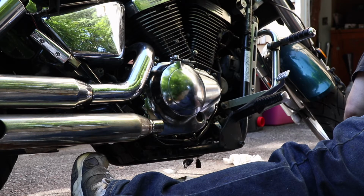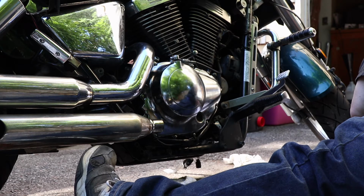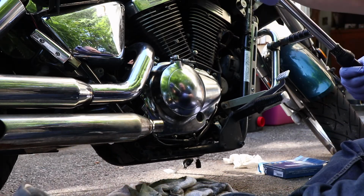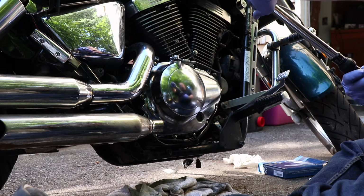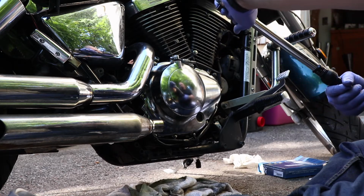Oil drain plug: 21 newton meters, 2.1 kilogram meters, 15 foot-pounds. So let's set up our torque wrench for 15 foot-pounds. And if we get a leak, I know I can safely go to 20 on it. It's set right now at 20, so I'm just going to back it off. This one is a little larger, it's calibrated in half foot-pound increments.